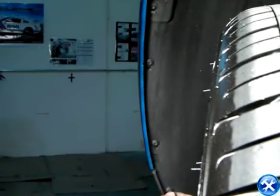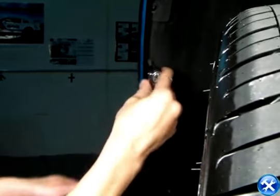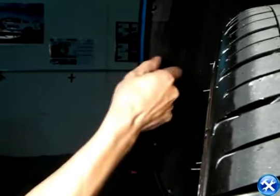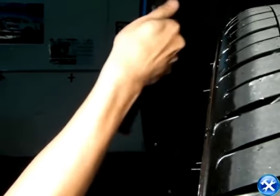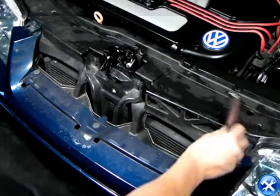Now to the sides of the wheel well. We'll notice that there are four screws on each side — these four screws are indicated with red arrows. Once the screws in the wheel well are taken out, let's work on some more screws on the top of the front bumper, indicated here with yellow arrows.